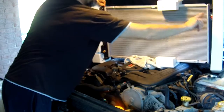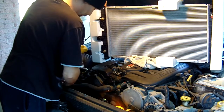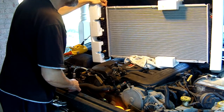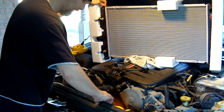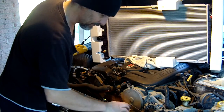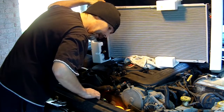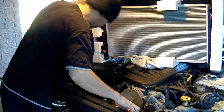This top hose right here, then the transmission line right there and the transmission line right down yonder. So we've got three to take off over here and one more to take off down yonder. We need to unscrew this from there and detach the fan shroud from the radiator.